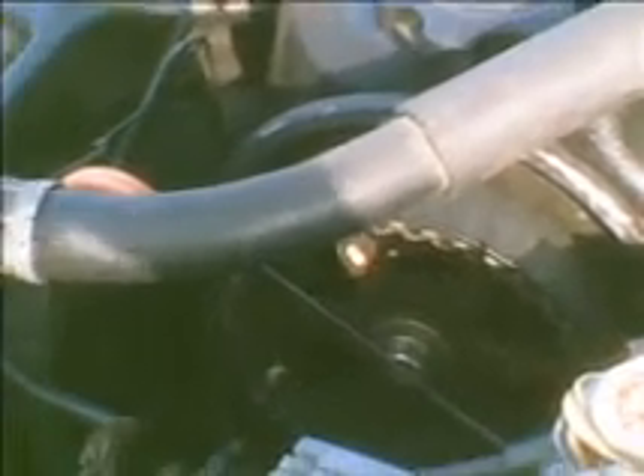Now you can see the marks coming around. There's one that says 'up' — it's hard on compression. Okay, we're coming up — you can see right here, it's coming up. We've got two others here and they need to be level with the bottom of the valve cover.